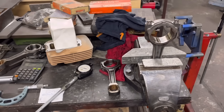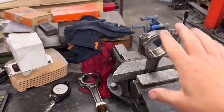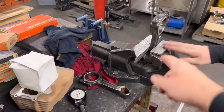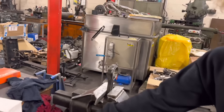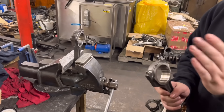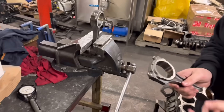These are the conrods for the transit over there that Isaac's doing. You can see he's lightly held them in the vice with the aluminium jaws - nothing too strenuous on them. So mate, what have you found with the housing diameter? Well, I've only done this one so far but that was all good - it's in the middle of the tolerance, so that's fine. It's not over-bored or anything.